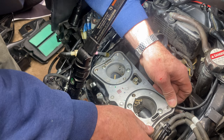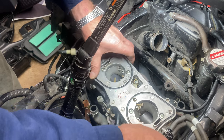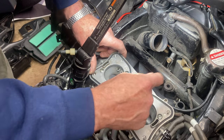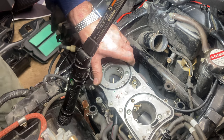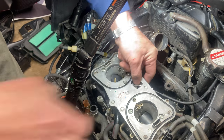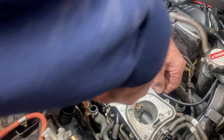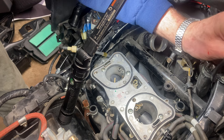What I'm going to do next is try to pop this out of the boot like so. Now it's got wiggle room, but your coolant hoses are down there so it won't move very far, but it'll give you enough room to back it up a little bit where you can get in there. Now you want to take your choke cable — there's a little Phillips screw. You don't have to take it all the way out, just back it out a little bit and pull it until you can get the cable out. You need some pliers to lift that little end out, and then the choke cable comes out. Set it aside somewhere out of the way.